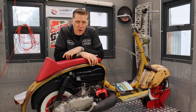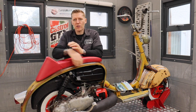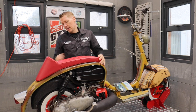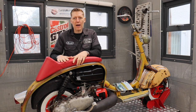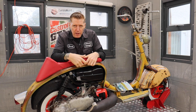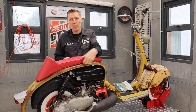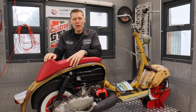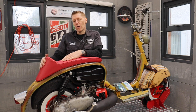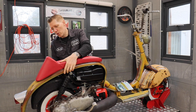Now that is about it for this episode of Cobweb Garage, but I don't know if you noticed in the footage, the seat still just wasn't fitting properly, so I didn't film it, but I came out here and basically I had to do away with the catch completely, and I also had to trim down the rubber feet that the seat has about halfway down, because both the mount and these rubber feet were kicking it up. So apparently this seat is meant for both series 1-2 and series 3, but maybe it fits a series 3 better than it does a series 2. Anyway, I'll show you what I did quickly.